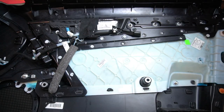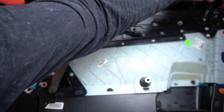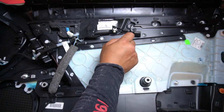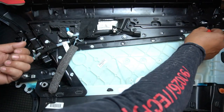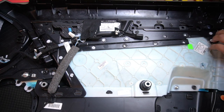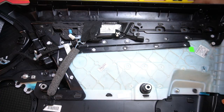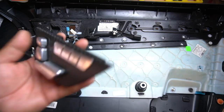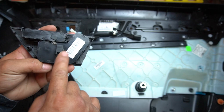Let's remove the five aluminium 10mm nuts — one, two, three, four, five. Take them out. The trim piece will now just drop out — push it out. That releases our trim piece and also releases the trim around our buttons. The one aluminium nut on this side releases this entire piece, so make sure you unplug everything.